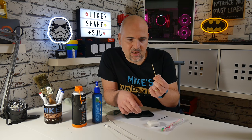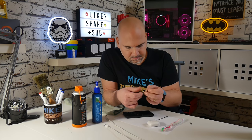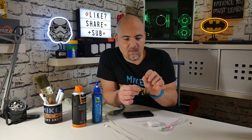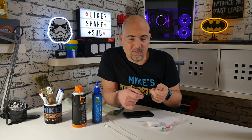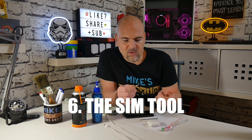These are fantastic — because it's wood it isn't conductive in any way shape or form, so if need be you can prod around in those contacts and not worry about shorting anything out. Another item is a cable tie or zip tie. The smaller zip tie is really good because they're quite fine and on the end is just a sharp piece of plastic — that sharpness is actually really good for getting rid of dirt and debris right inside the connector. The last one is a SIM tool, the sort of thing you get from most mobile phones to release the SIM tray. It's quite fine and thin so it can get into most places, but because it's metal it is conductive, so do be very careful if you use one of these.